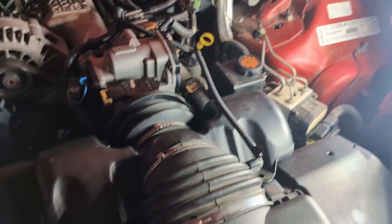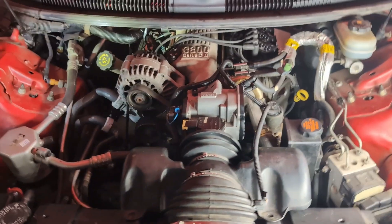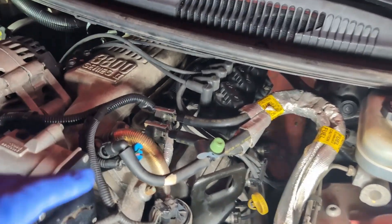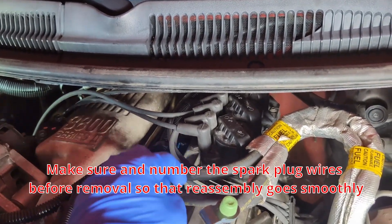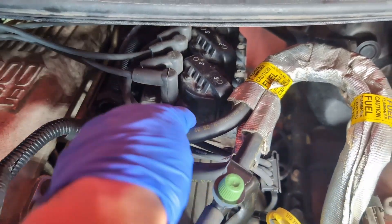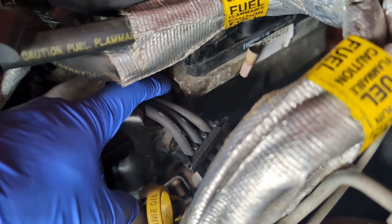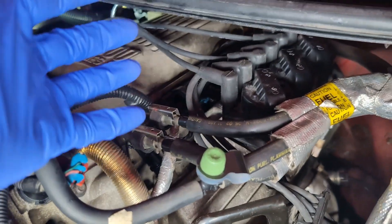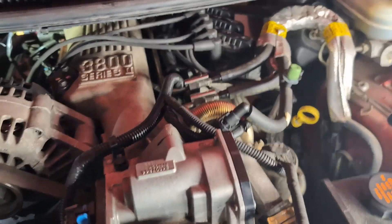To do this job you don't have to be a genius — there's only a handful of bolts; you just have to finagle because there's not a lot of space. To start, you'll work on the coils over here. Take the spark plug wires off all six coils, then there are two bolts on the inside of the rail and one bolt on the outside. You can get to it through a bracket — there's a hole in it. Once you get those bolts off, you just slide the coil pack to the side; you don't have to unhook it from the car.